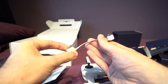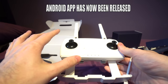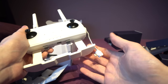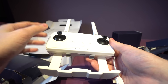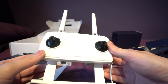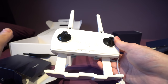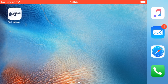Lastly we have a USB adapter which is an iOS adapter. At the making of this video the Android app isn't ready yet, but I'm told by the time this is released the Android app will be ready on the Play Store. Just like DJI, this plugs into the side where it also charges, and then this goes into your iOS or Android device and your phone goes in there. You can select Mode 1 and Mode 2. We also have a Sport mode and a Normal mode. As far as I can tell you cannot turn off GPS mode, so there's no attitude mode — I would have liked to have seen that. To arm the copter it is both sticks out.